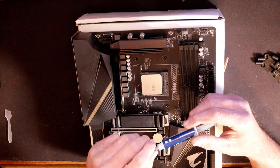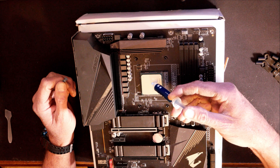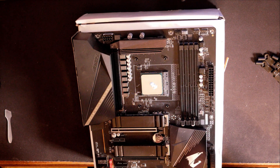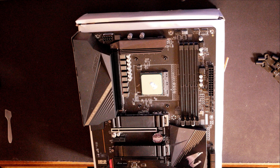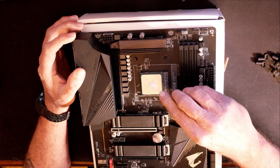Personally, I like to spread mine out — I'm old school. That way, if I put too much on, I can take off the excess. And by spreading it out, I also know that I get good complete coverage of the CPU. I'll go ahead and start spreading it out here.